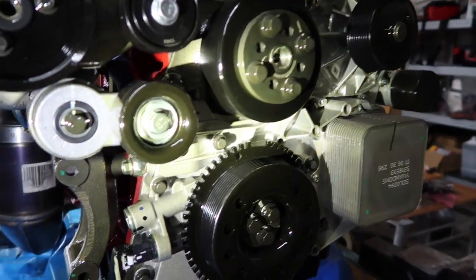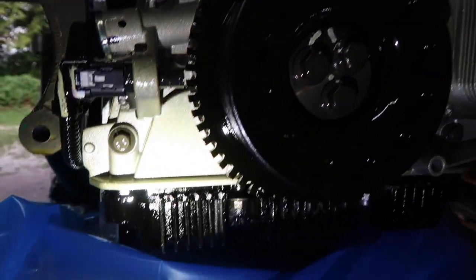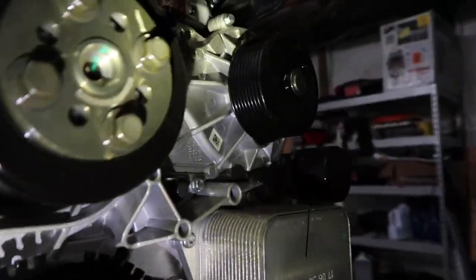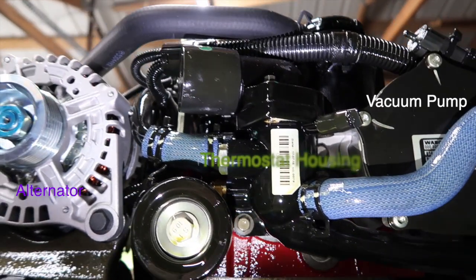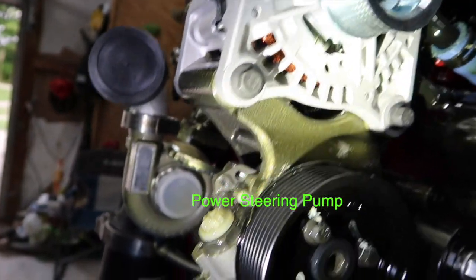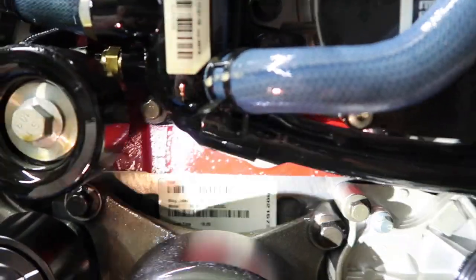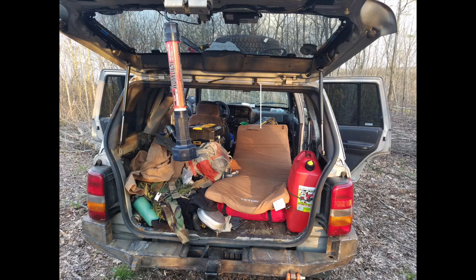Man, I went with GPS, and then that also means later I didn't plan on it, but it's gonna be a bit of a benefit for me when I go to an Atlas, because I do want to go to an Atlas 5-to-1, maybe an Atlas 4, and then I get some more options there. Because yes, it would be nice to maintain the stock ratio and then also have the low range. But honestly, I think that's overcomplicating what I do, and I think it just gives me too many extra shifters. And again, I want a pretty good degree of simplicity.